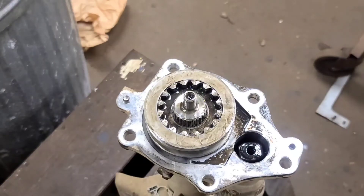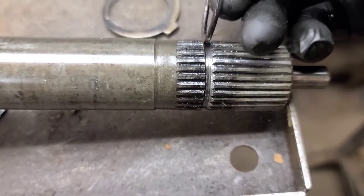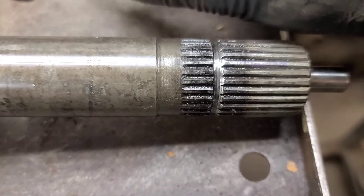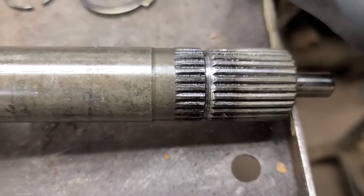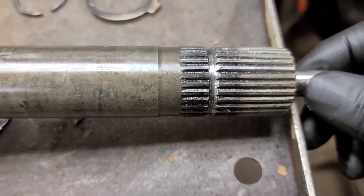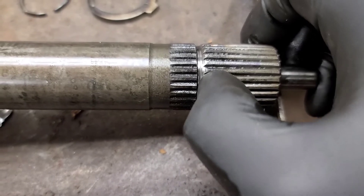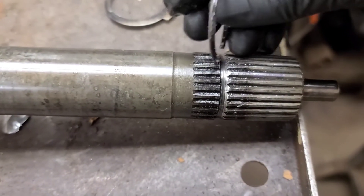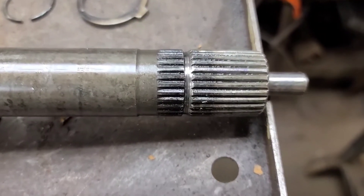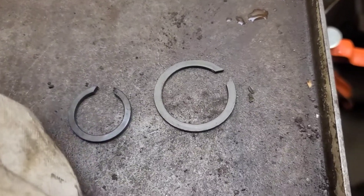Here's another look at this shaft once I took it out. You can see where the snap ring sits - it's actually worn the teeth on the gear because of some side thrust. You can see this wear on this washer - that's the only thing that holds this axle in. I'm sure that these minor lift kits put more thrust on the axle shaft in that direction because the CV shaft is working at a steeper angle. In my opinion this would be better if it had a square snap ring in here instead of this type. I wonder if we can find a square snap ring that fits in there or if we could actually machine this groove.